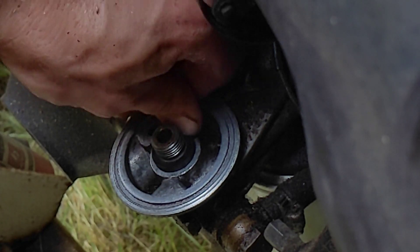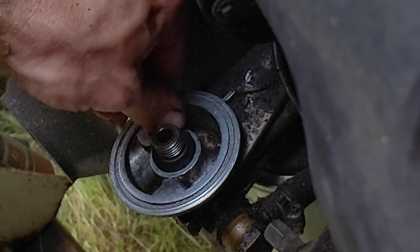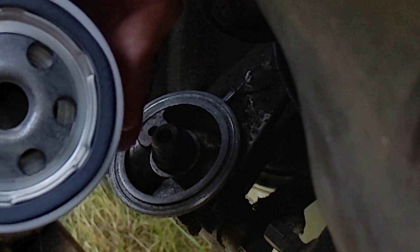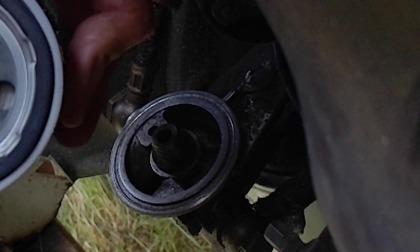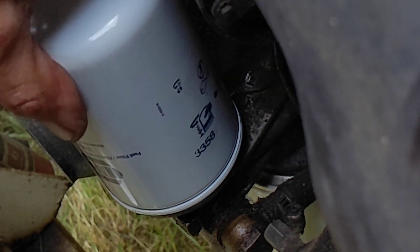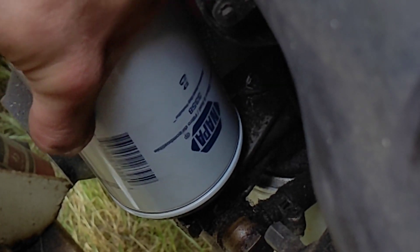Got the new gasket on. Take your time — there's some thread relief down at the bottom of the threads there, you've got to work it past that, stretch it over the shoulders to get it nice and flat on the surface so that the filter seal is good. Since I'm not in the garage, I just pulled up the dipstick and got some oil on my finger so I can put a light coat of oil on the seal on the new filter. Make contact and then go three-quarters of a turn — that'll put the NAPA logo right there.